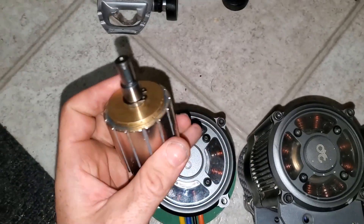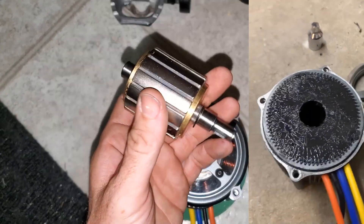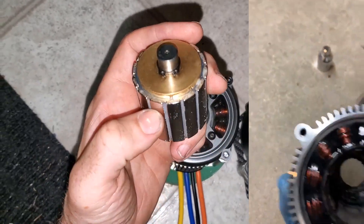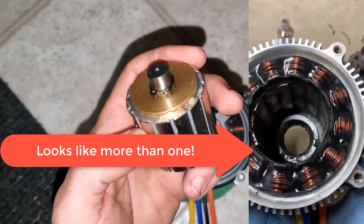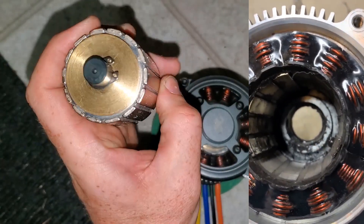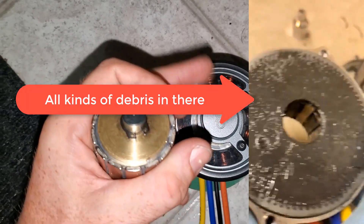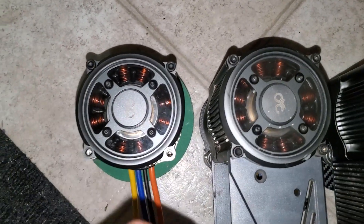In the beginning, the motors had rotors that looked like this, and what was happening - at least in one case - is that one of these magnets came unglued at high RPM, like 13, 14, 15 thousand RPM. The results are predictably catastrophic once the magnets are loose inside the casing, just crushing around and basically turning into dust and a big mess.